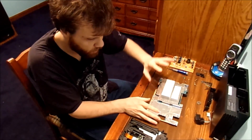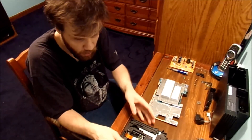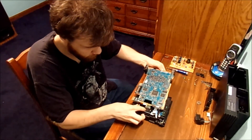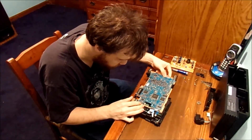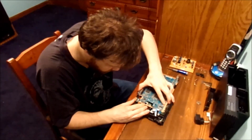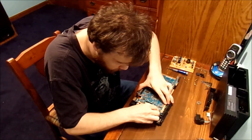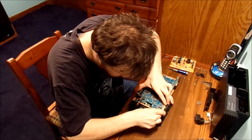We've got a new battery inside of the PlayStation console's motherboard. We already put the shielding and heat sink back onto the board. What we're going to do is replace the CD and DVD drive system and put it back on. Flip it over, and we just want to make sure we get everything lined up here. It's a bit of a challenge to get this console back together, but if you're very careful, you can get it all back. Now I'm putting all the ribbon cables and stuff back in, making sure each ribbon cable goes back into its original slot.